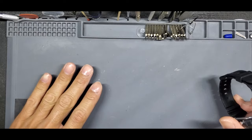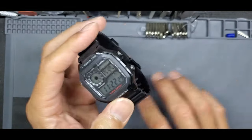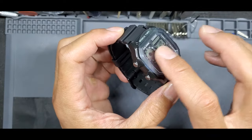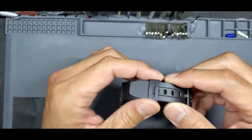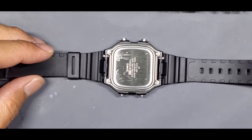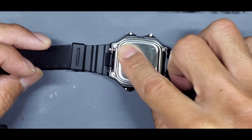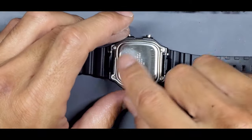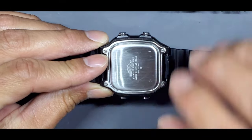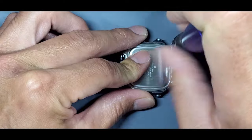You want to make sure that you have a nice soft surface to work on. This is a silicone soldering mat so it doesn't scratch — especially on these Casios, these are very easy to scratch. I'd even recommend putting a piece of painter's tape over your watch glass when working on it. I have the factory piece of plastic here that sticks to the front, so I'm just going to leave that on for protection. This watch is brand new, and in traditional Casio packaging you're usually going to have some residue on the back. You can just take a little bit of alcohol on a microfiber cloth and rub that off. Also expect some superficial scratches that will not be removed by traditional means.